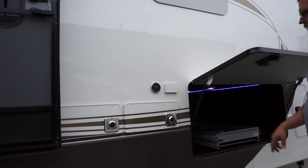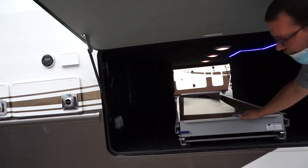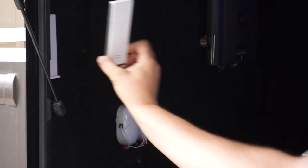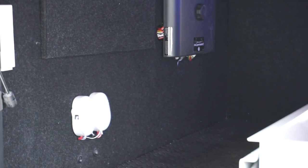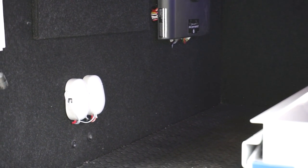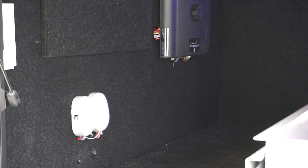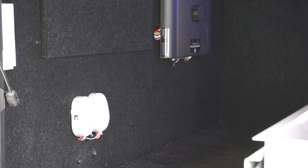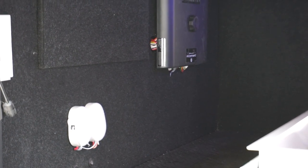On the back side down here you have two little white eggs — those are your wind sensors. There are also two wireless remotes here for your awnings, with little round on/off buttons underneath. When you're traveling, those need to be in the off position as a protective mode so that your awnings don't go in and out from the vibration of going down the road. Make sure those are off when traveling.